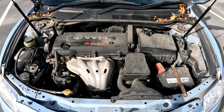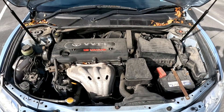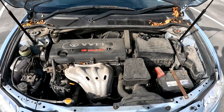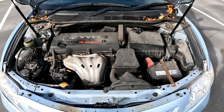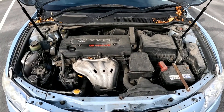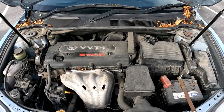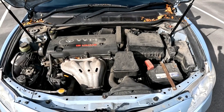On my BMW, which has an electronic water pump, there's a bleed procedure: put the aircon to low, put your foot on the accelerator while the car key is turned on but the engine is not running, and after 15 seconds that initiates the water pump bleed procedure. That car is quite easy because it has its own built-in way of doing it.